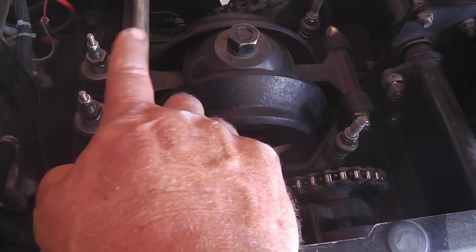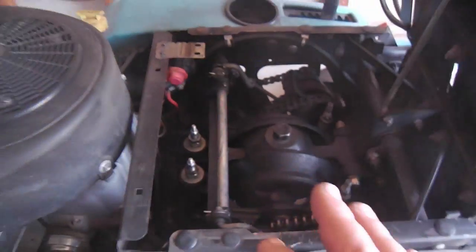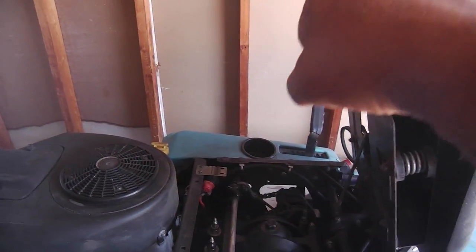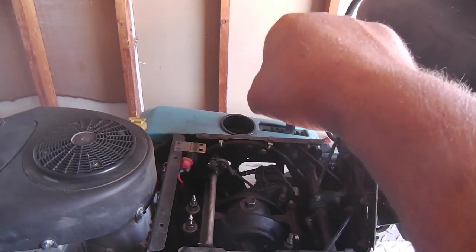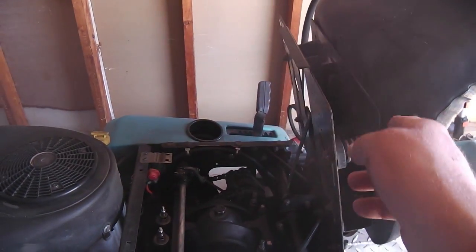On the left side, it's counterclockwise to speed it up. I don't want to speed it up on the left side. The left side is fine. And you can always know which is the faster side when you're running the levers: whatever lever you have in the forwardmost position is the weak side. Because on the other side, you have to hang back a little or you'll start turning, because it'll outpace the right side.